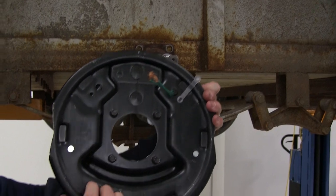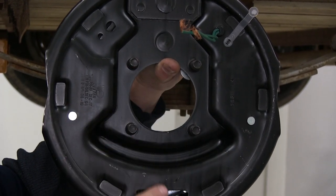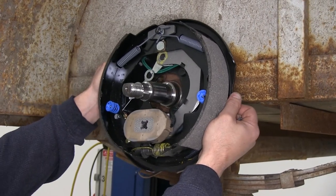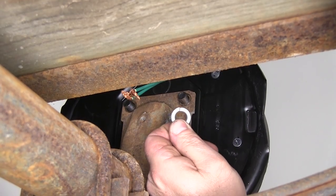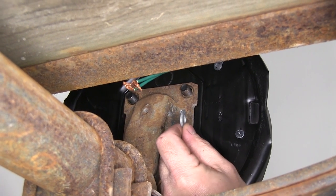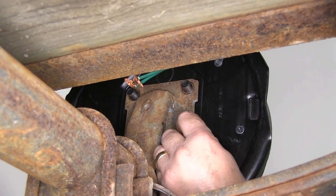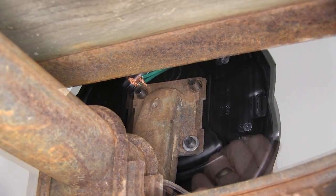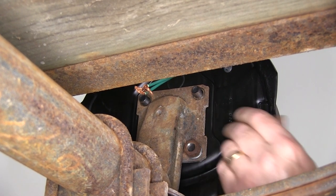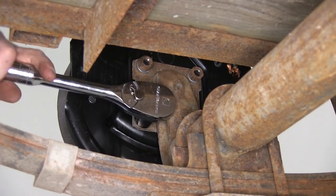The back side has four studs that will go through the mounting flange, as well as two wires that will be connecting. We will be reusing the nuts taken off the old brake assembly. Go ahead and line up the four studs. We're going to add lock washers, part number 5-8, because they were not on there previously, but it's a good idea to have them underneath each of the nuts. Slide the lock washer on, then put a nut on, and repeat this process for the other three studs. Now we'll go ahead and tighten everything down.